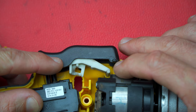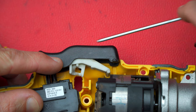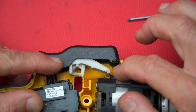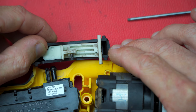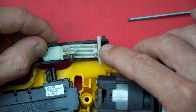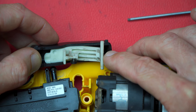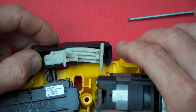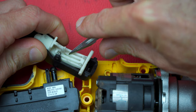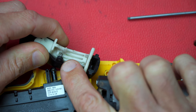One thing I don't like: if you look closely over here, that's a plastic pin. This entire switch mechanism actually pivots inside here on that small little pin — it is of course plastic — and over time that little nib, which is not very thick at all, can break off on either side, and once that does it's going to pretty much render the pedal system useless. It would be nice to see that as some type of aluminium section or steel pin into an aluminium housing, although that does cost more. There are no material markings on this, but scratching a small amount off I can feel there is glass fiber reinforcing as it cuts the fibers.